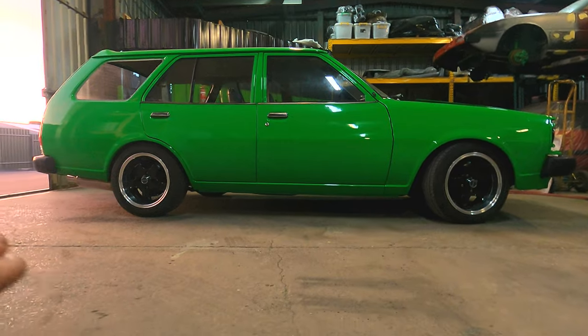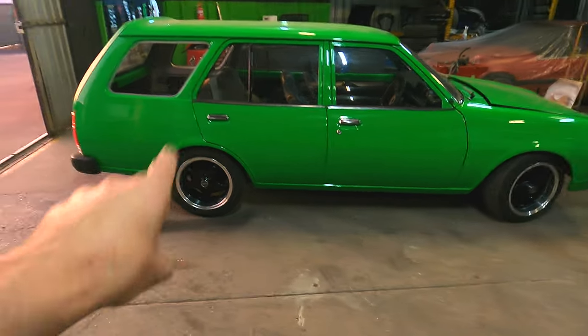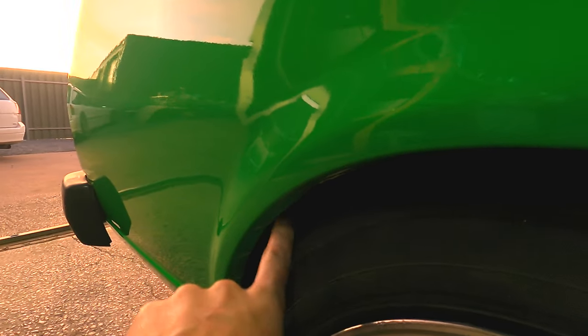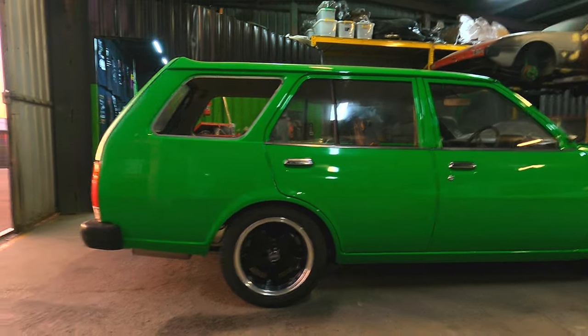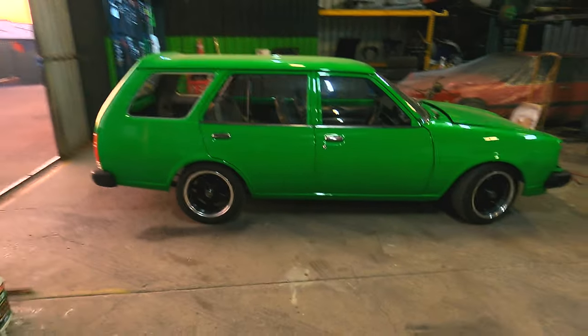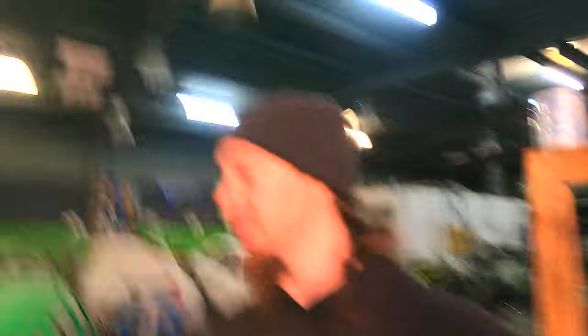I'd really like to get the steel panel a little bit more level with the ground. But if I lower the back with these rims and this offset, the tire's pretty much just gonna eat the guard — I can only just get my finger between there. So it probably can't really be any lower than that. I'd love the guard just sitting on the top of the tire, another inch lower, but with those offset wheels it's not going to happen. I really love the look of the car with these wheels on it though, so I think I'll roll with it for now and maybe change to something different in the future.